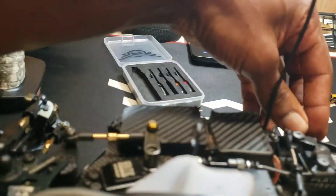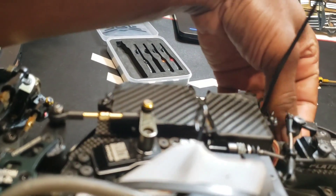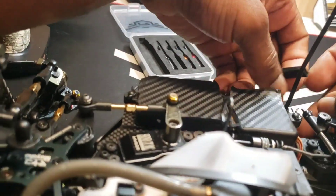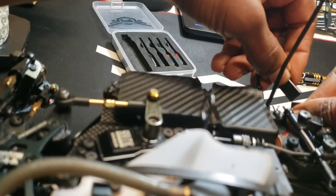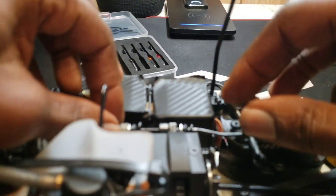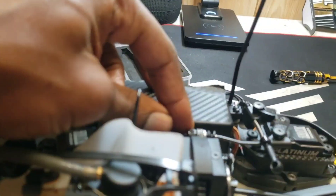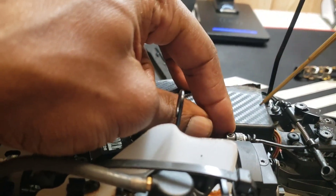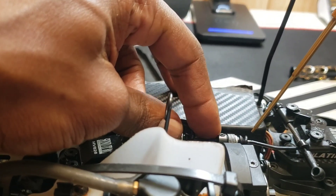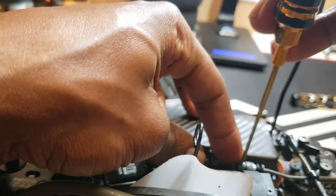So what I'm going to do is I'm going to plug everything up so the servo will be in the position where it's going to be when you turn everything on. Turn the car on. So now I'm going to adjust — charge that radio up — and I'm going to adjust this. Push it back where it's a little tension on the brake but not a lot.